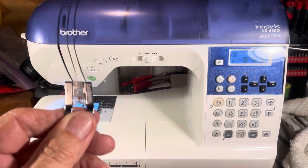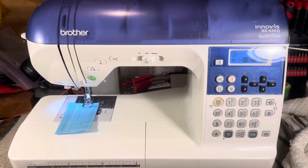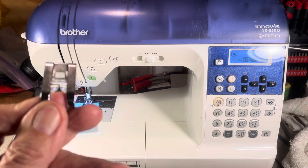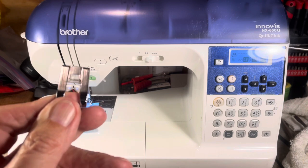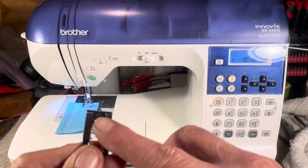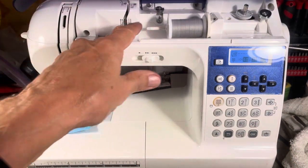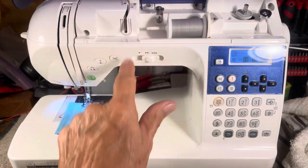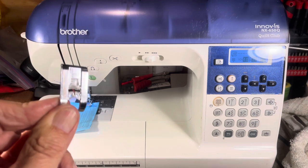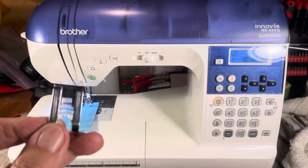She took it into another dealer — who I will not name. I started out in this business competing with their grandparents, and now I'm competing with the grandkids. Rather than looking underneath and seeing the feeders — feeders are very hard, very rarely do they wear out or need to be replaced; I've seen them break but never wear down — the bottom of your presser foot is a base metal like copper with a thin chrome coating. Everything that touches the fabric and thread is chrome plated because it's hard. When the feeders do a number like this, it'll feed crooked no matter what. So they put new feeders on and charged a lot.